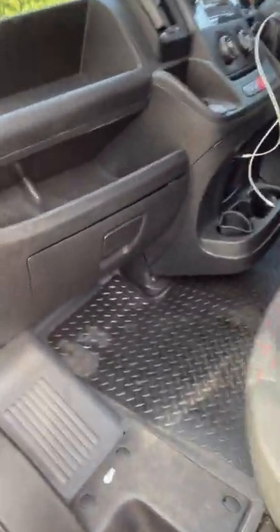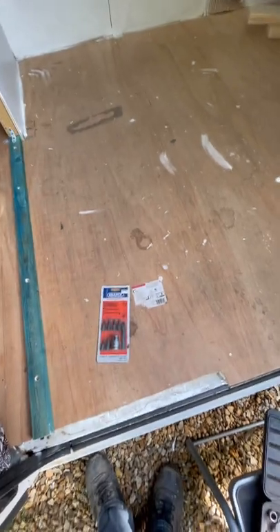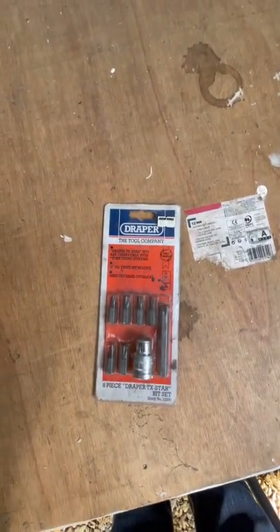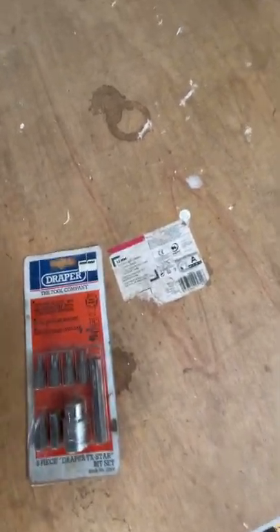Looking under the seat — that's the seat base. First thing we do is protect this area out because we don't need that. The jack and stuff is in there. According to the instructions, we remove the two front bolts — used later — and the two back bolts, which are Torx. Fortunately I bought a Torx set years ago to do something on my bike. Very rarely use them, but thank god I've got them.